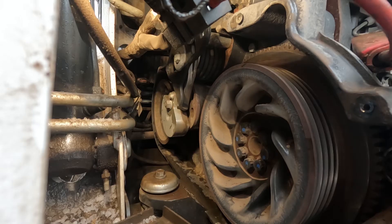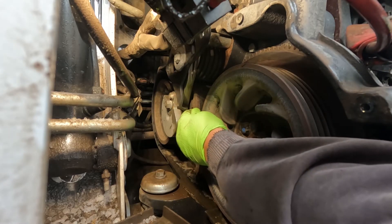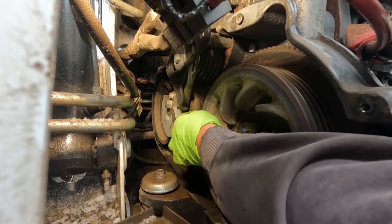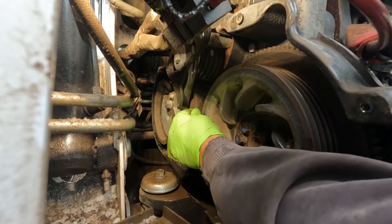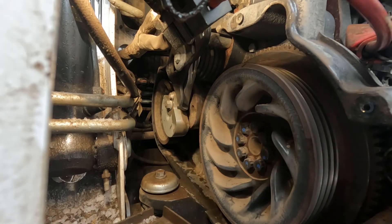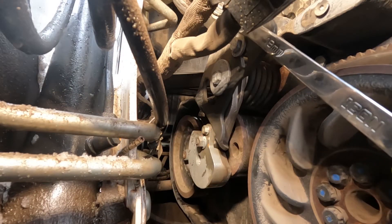This is a relatively low-hour machine. What causes the belt to break? Well, there's no good answer for that. The first thing I do is check the tensioner pulley itself right here, and I don't find any play or slop in those bearings. So I think I can just replace the belt and put it back on — I don't know why this one broke, it could have been just a defective belt.